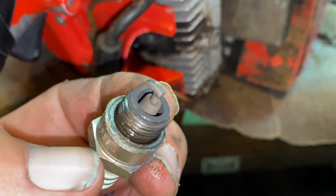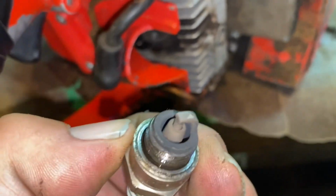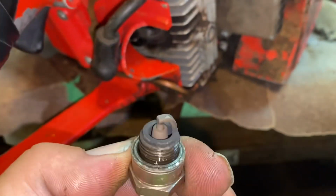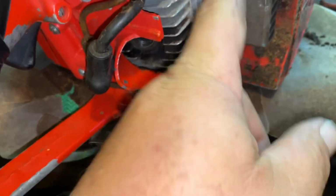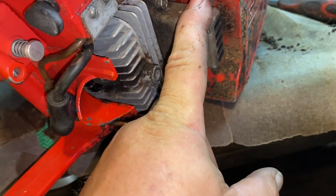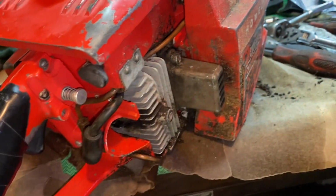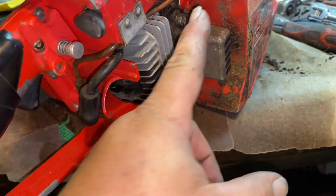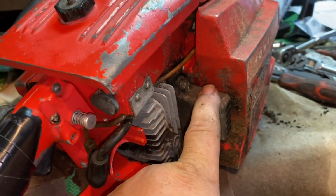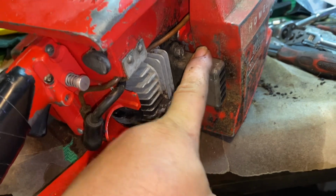I thought it could be even leaner than that. And I thought the saw was a little too lean in the cut on that last video, which is probably the exhaust port being cut too high. I think that's what's causing that idea that the saw might be too lean when in fact it's not. I think it's just because the exhaust port's so high and the saw's so zingy.